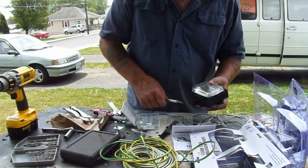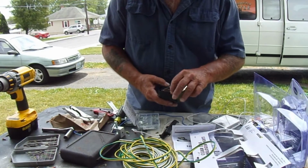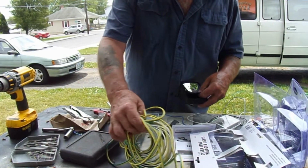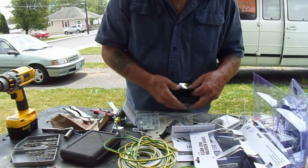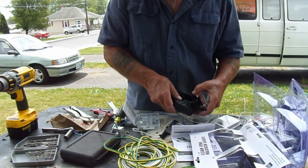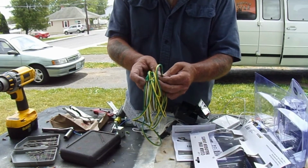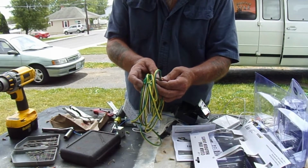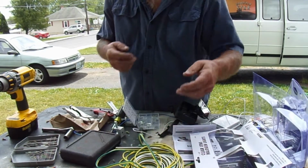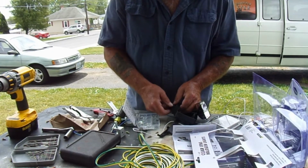And I'll tell you what, when you're doing a little bit of electrical wiring with a car, you don't want to go buy a big spool of wire. These little trailer hookups are quite the deal. You just designate one as a ground, because you've already got a ground, the white. But if you're using them in two different places, what I like to do is I'll designate the white and the green as grounds, and the brown and the yellow as powers. And you can get these in 25-foot rolls and split them apart and just have yourself a grand old time.